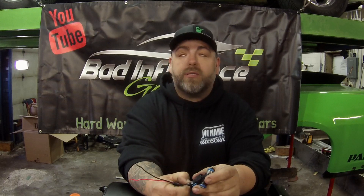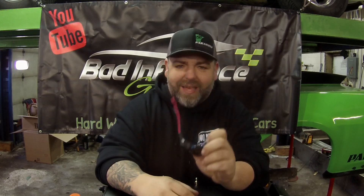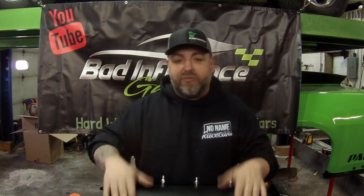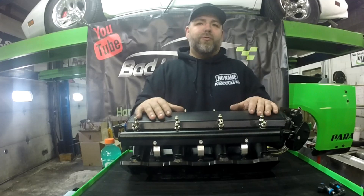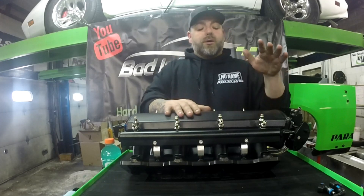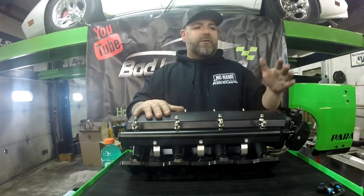We have a nice 90-degree boot supplied by FuelTech to make it look clean. This is a 102-millimeter throttle body, so we're going to increase flow quite a bit. Matched with our ported heads — we're porting a set of 241 heads, which is what came factory on the LS1 — along with a big bump stick, stainless braided brake lines, radiator stuff, and nitrous controllers, all to try to make this a 10.5-second car.